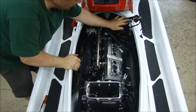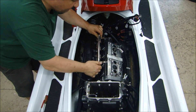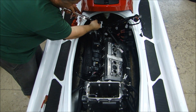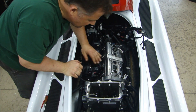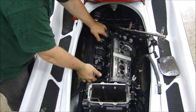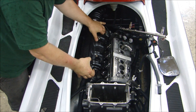You can see I have the wiring harness out of the way and the fuel rail disconnected. I'm going to pull the fuel rail up like that — it's on a clip. I'm going to disconnect this hose and pull the fuel rail out of the way. Now I've got a good shot at my intake manifold and my valve cover. I'm going to have the intake plenum loose and pop this right out.